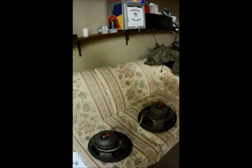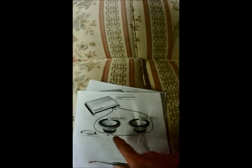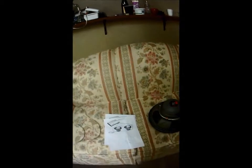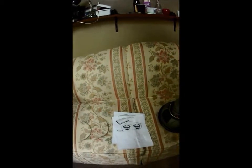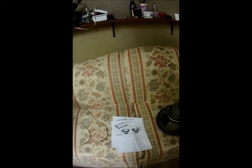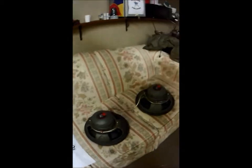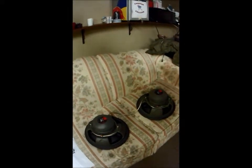I'm not interested in competition — I just wanted some bumps in the trunk, got these subs really cheap. The diagrams show two-ohm single voice coil subs running at four ohms, and I'm like, we don't want to run that way. It's showing a series circuit, negative to positive, which is what we have in place, but to get to two ohms we also have the second voice coil creating a parallel circuit, and that knocks the number in half to two ohms. It's important to know what your amp is capable of — a lot of them are stable at one ohm now, this one is stable at two, four, or eight. You gain almost a third more power going to lower ohms — lower resistance means more power flows through more easily — but if your amp isn't rated for it, you're going to overheat it and blow it up.